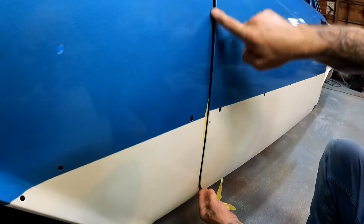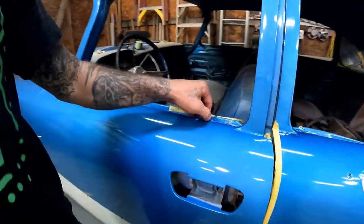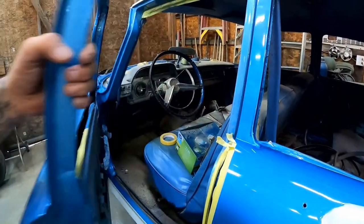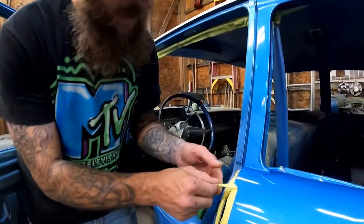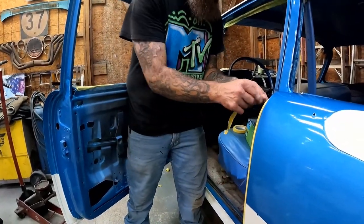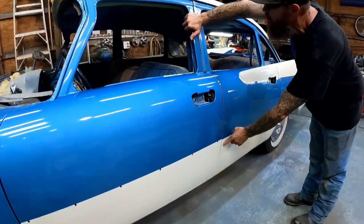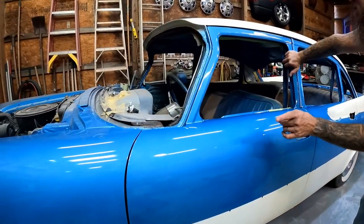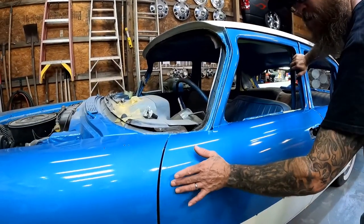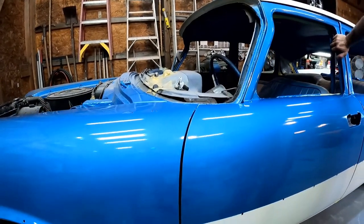Look, we're not rubbing anywhere, so that's always good. Since we've got it on the car and we're not doing a whole lot of movement — just barely moving it here and there while it's still fastened to the car — we don't really need all the protective tape anymore. You can see our gap running down the door here, nice and straight and consistent. I do think I might need to bump the door that way just a tiny bit, but everything is lining up really good.